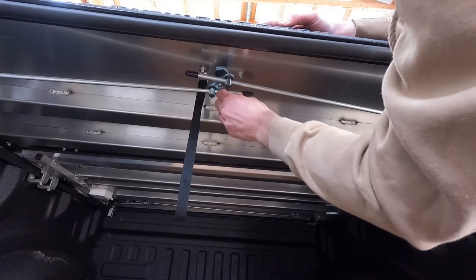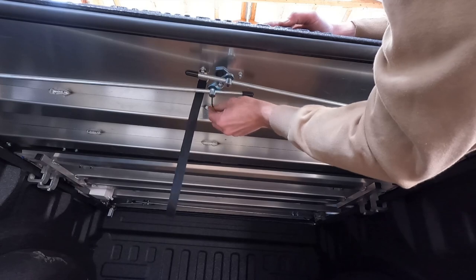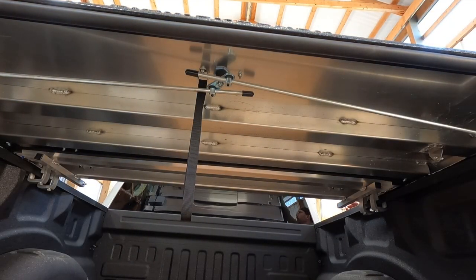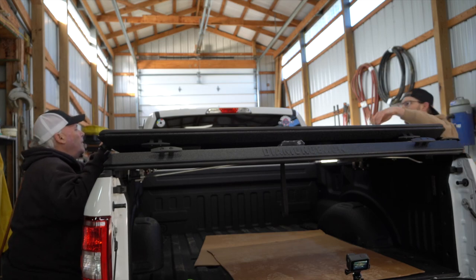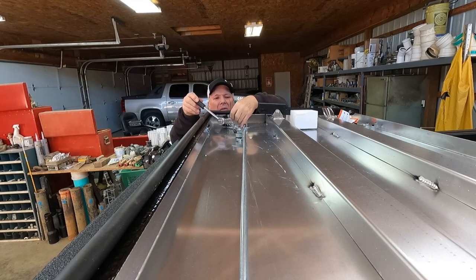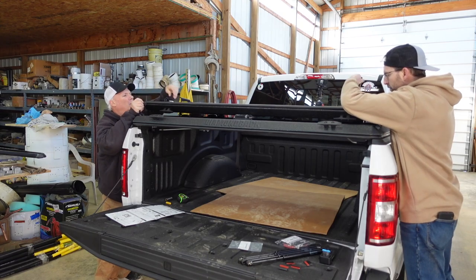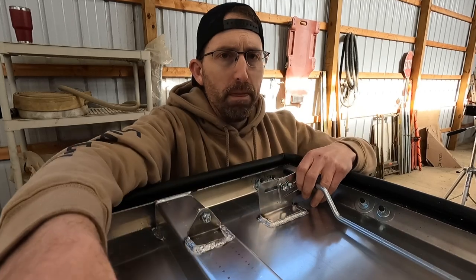You'll probably have to loosen and adjust quite a bit just to get the right fit. These are aluminum panels, and although the aluminum is very solid — I said you can drive an ATV on top of it — if you tighten one down too tight you can get a little warpage and affect the seal. So we got the back one done and moved forward. That cardboard was a lifesaver for sliding in and out, since that spray-in liner is really sticky and hard to move around on. Getting the locks adjusted for the other panel also takes some time to get just right.